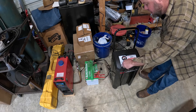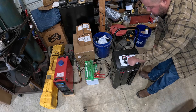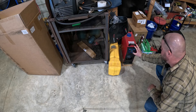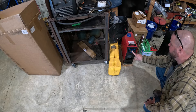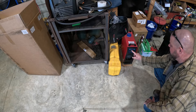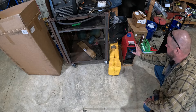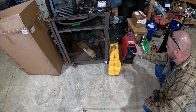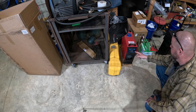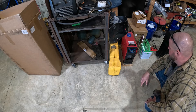I'm going to go to the 6-amp mode — that should provide a good steady current to the battery. We'll kick this on to 15 minutes. You can see the amp output is on. We're already showing 14 volts on the screen because the charger's on. If I were to take the charger off, I guarantee we'd go to 12 volts and then it would pull down to 10 or 11 volts once this glow plug kicks on. So as long as this battery charger can maintain that 14-volt charge while this is pulling, this is going to ignite no problem and make my work area nice and comfortable.